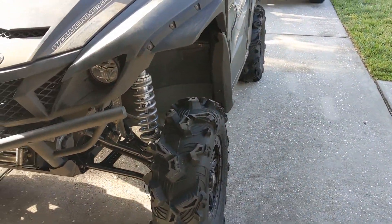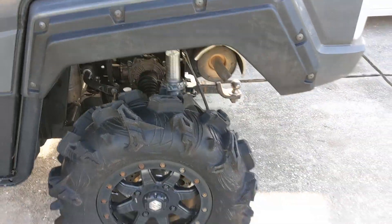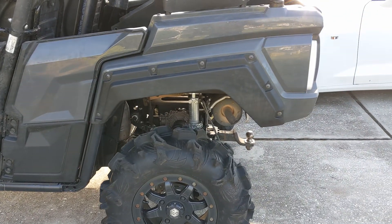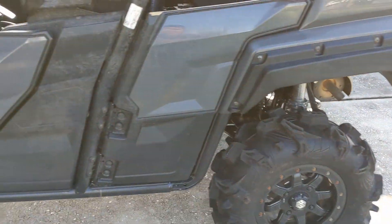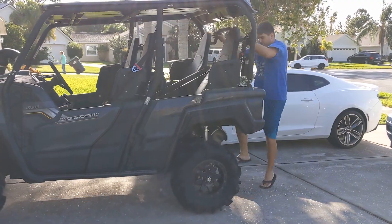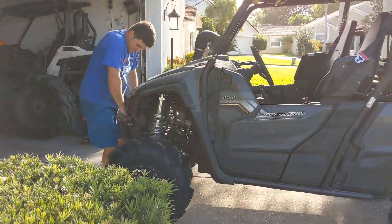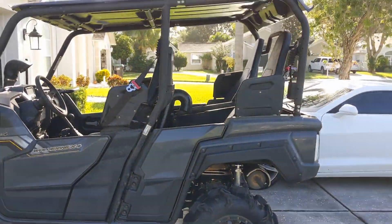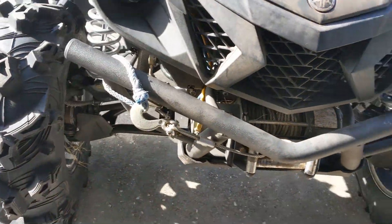Probably wouldn't buy these shocks again. I've got a lot of complaints and things I don't like about them. Probably gonna get the Walker Evans and try to sell these to someone who wants to make the same mistake I did. It did achieve its purpose for me, which was just to get a little more ride height for mudding. But if you're gonna buy these for desert racing or something like that, I don't think you'll be happy with the dampening. I'll do a little jump test — clickers are set at rebound plus seven and compression plus three. Pretty good damping. The front's pretty springy so I'll probably have to increase the rebound dampening on the front. The shocks are nice and shiny for now and it's sitting a little higher, so I guess it was somewhat worth it. But for the money, I should have just invested in the Walker Evans — this was kind of a pointless endeavor.